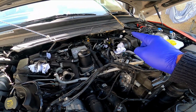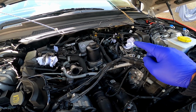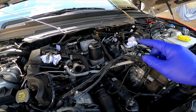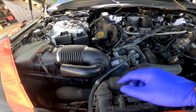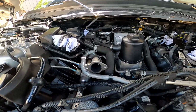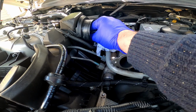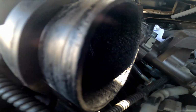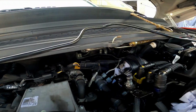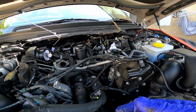This auxiliary turbo will have an oil feed going in and out, but the turbo's not running, so you may well have a small build-up of oil within that turbo. And as you put your foot down, that oil's puffing out the back, and it's also going into the air intake, or the charged air intake, causing oil to go into the inlet. And as you can see in the inlet here, I don't know how well you can see that, but there is a lot of carbon build-up in each of the four air intake or charged air intake inlets.